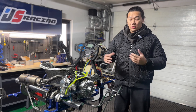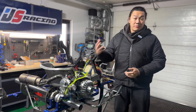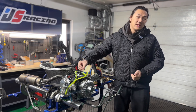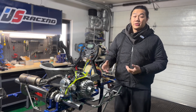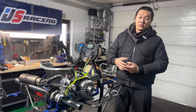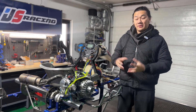These engines are originally designed for operating at 2,000–3,000 RPM, so that's not too much of a problem. But when we're pushing it up to 6,000–7,000 RPM, that becomes a more accentuated problem. By connecting a tube to the cylinder head, we're essentially allowing the air pressure to escape through the canals in the cylinder head, which is going to improve the engine response somewhat.